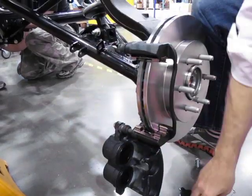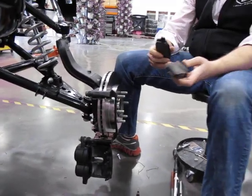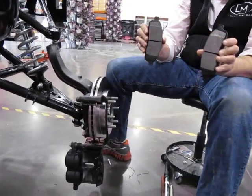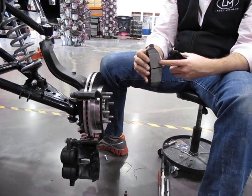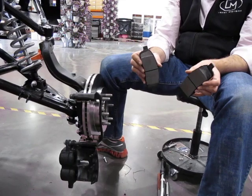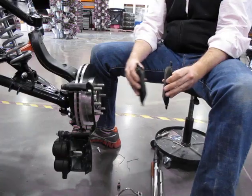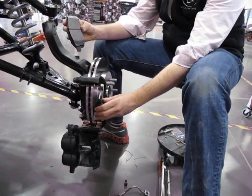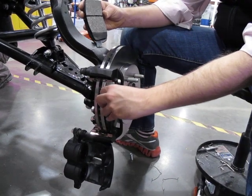This provides a surface to mount the brake pads. The brake pads follow the curvature of the rotor — you can see they're both curved like this. This is the brake pad business end, the part that has the material that wears down. You match those up to the curvature of the wheel with the brake pad surface facing inward, and slide them in from the outside into these channels.